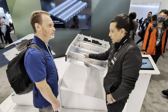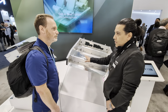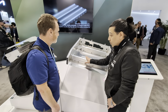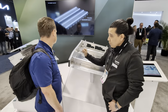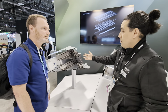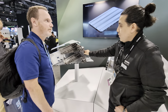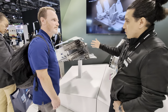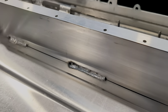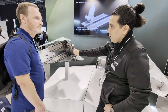We have different solutions. This is an aluminum solution — if you're looking for light weighting, aluminum is the best way to go. The disadvantage is increased cost since aluminum is more expensive than steel. But it's a very good solution for lightweight and energy absorption. For steel concepts, the advantage is better cost and good protection. With steel you can have several grades of materials — it's not just one piece of metal, it's different materials with different properties. Cross members use high strength steels that will not deform during a crash. It's very important how we design these battery frames along with the vehicle to absorb energy before any contact with the batteries.